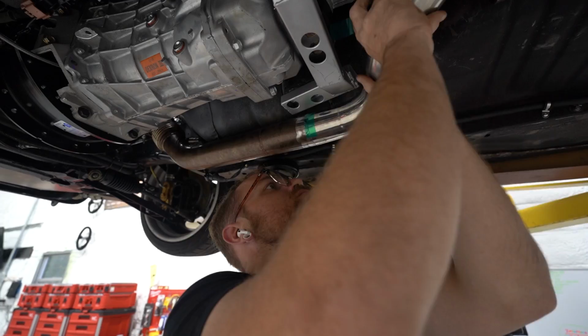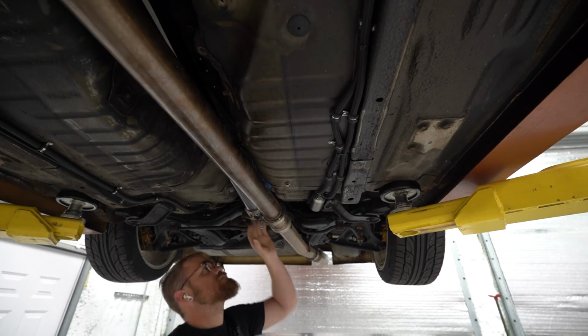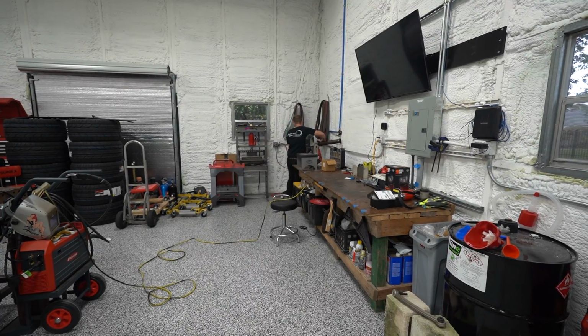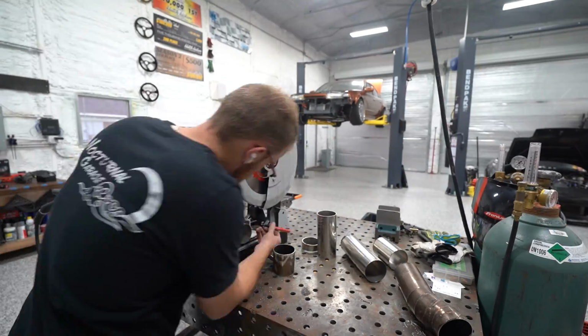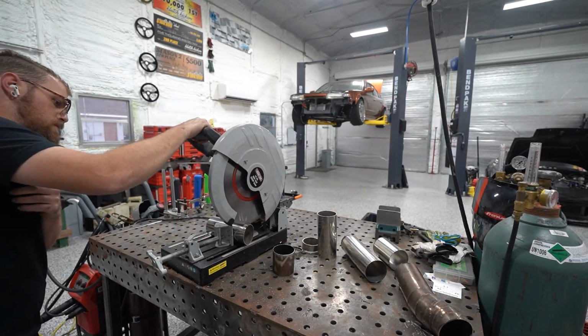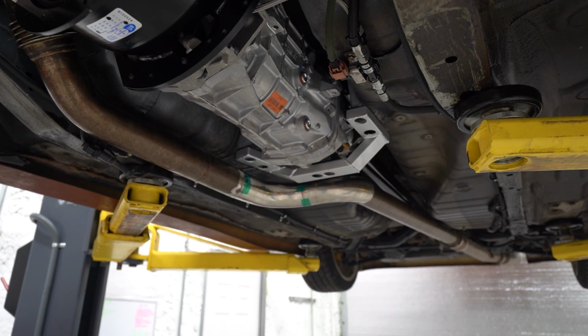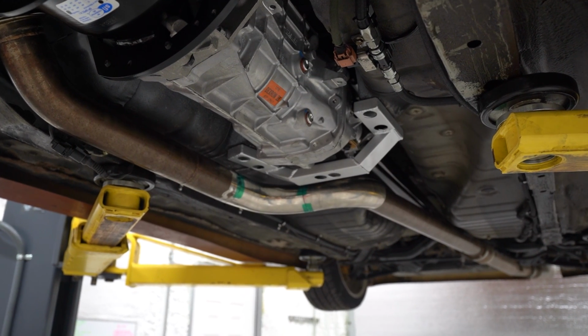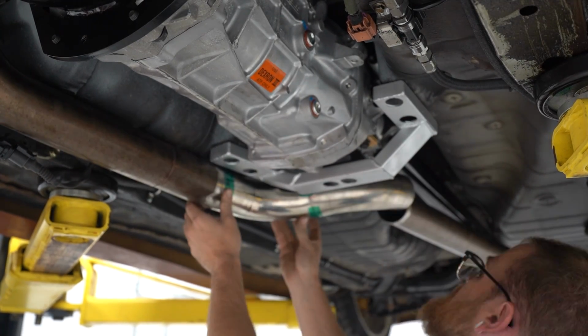So first, we need to finalize our new piece section. We need to get it taped and get it marked exactly where we want it so that we don't have to worry about that changing and our new piece that we're trying to make not fitting. We also need to get the back section cleaned up and ready to weld. So once this is all in together, we don't have to take it all back apart to clean it up to get it ready to weld. So we start cutting a few little pieces. We've got everything mocked up in there, but it is a tricky combination.